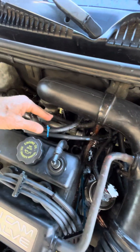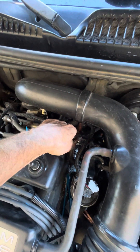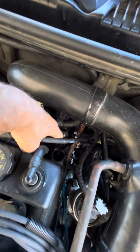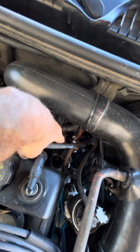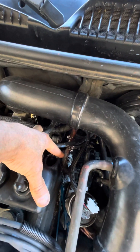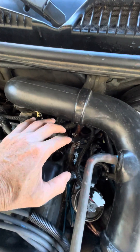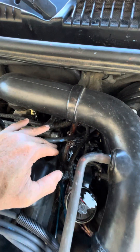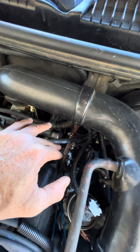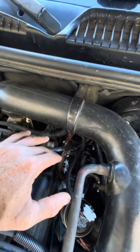There's a heater tube that's part of the ABS manifold — this piece here — and a common problem on these Generation 2 Saturns is they leaked through this. I was able to, basically following up on someone else's video, invent a different way to repair this heater tube, and also to repair this broken nipple. The leak was so small and difficult to find because when the engine got hot there was no residue. Once I found it, I have a whole separate video — ABS repair, no manifold removal — it's on YouTube. In any case, I thought that would take care of the leak, but it didn't.